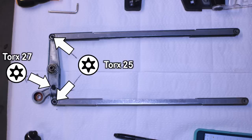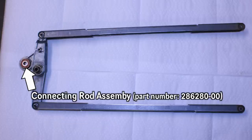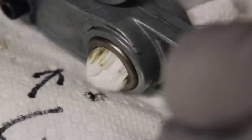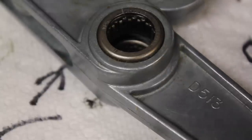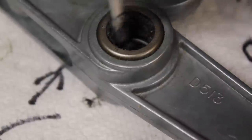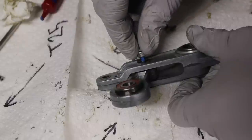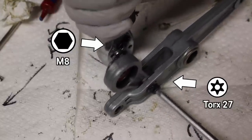That's how your tool lasts for over 10 years. Here's a closer look at the rocker assembly and the Torx sizes for the screws and the bolt sizes for the ratchets. This bearing is completely sealed — you will not be able to service it. If there's something wrong with this bearing, you will need to replace it. This section of the saw gets the most punishment, and there are two bearings in there — you really want to make sure you get this the most clean and the most lubricated. When you reassemble, this screw needs thread locker. This is where a lot of problems and noise occur in the saw, so you really want to make sure this bolt does not go anywhere.